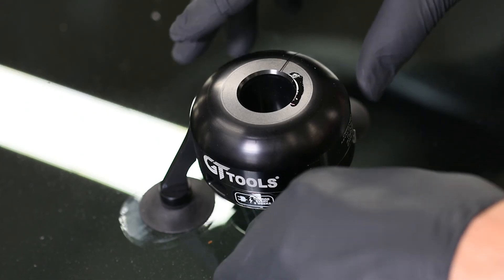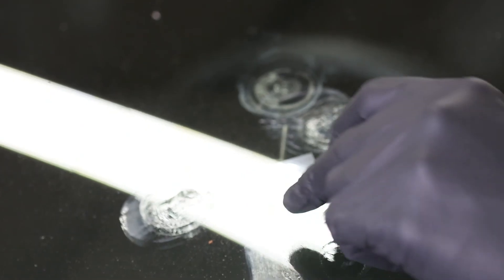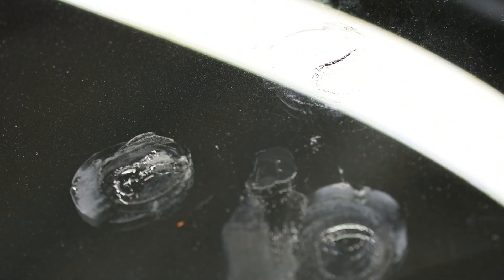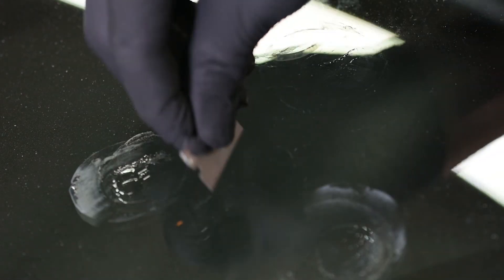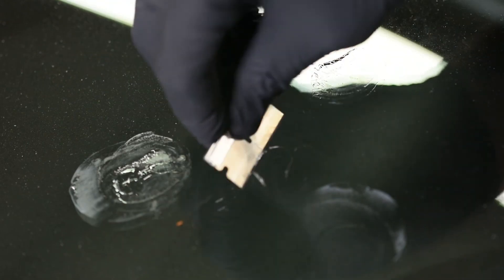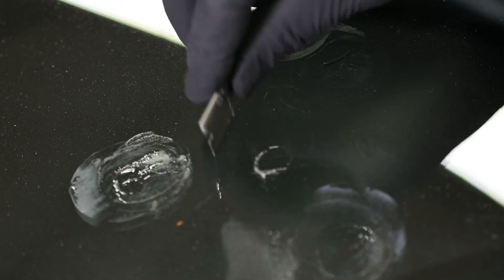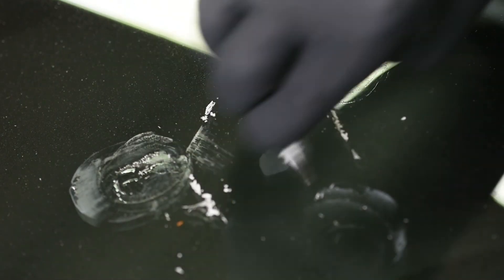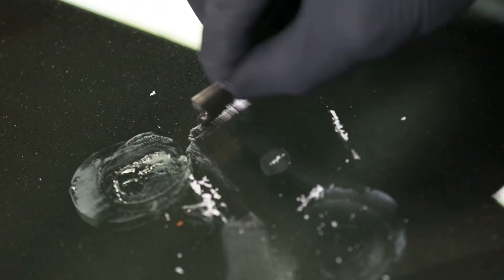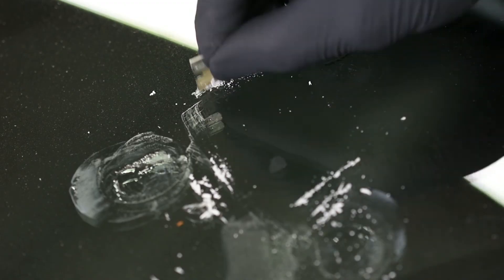Remove the bridge from the glass, remove the curing tab, and remove the mirror. Then take a razor blade and shave the excess resin off the surface of the glass. Hold your razor blade perpendicular to the glass and shave off the resin until you have almost a flush surface right over the pit area. When you have just a little left, stop and we'll polish it flush.